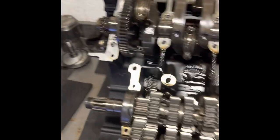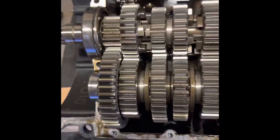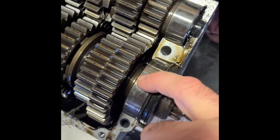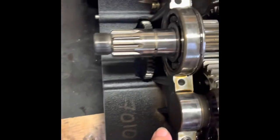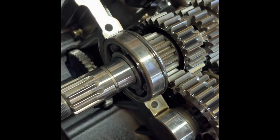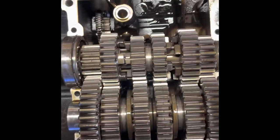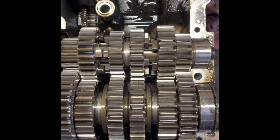As you can see now, the whole base is off to one side — it all comes off with the oil pump drive in there, all in one piece. A few things to keep an eye on: there's a snap clip shim to hold this bearing in place, and these bearings here are pegged. In the top side of the casing there's a small hole so if a bearing jumps out it can't rotate. Same with the other one.